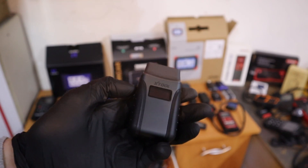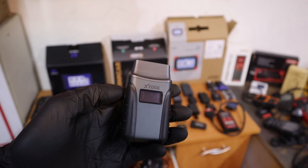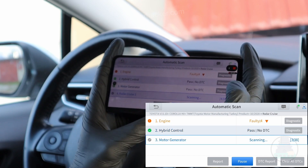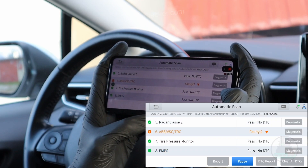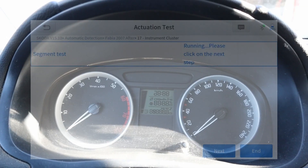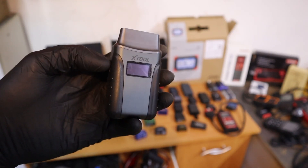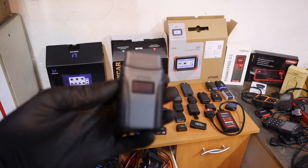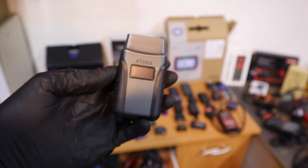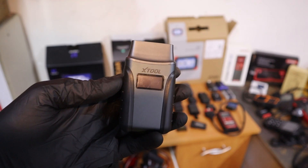The Xtool A30M is the best highest version of the Xtool A30, and comes with 21 service procedures. In this tool you will have everything you might need as a DIY mechanic: you can work with every control module, do a full scan, read data, clear faults, and do bidirectional testing in every module. It also has free lifetime updates, so not only do you not have to pay a subscription, you will enjoy updated software for life. However, this scanner does not have ECU coding, so no unlocking hidden features and no coding replacement modules.